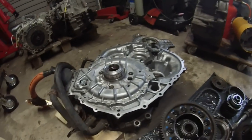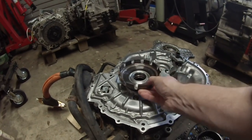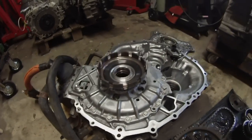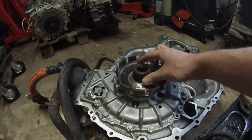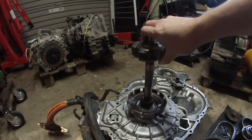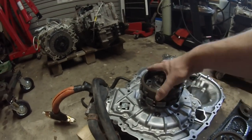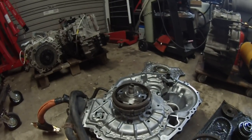That is because of this part here which sits in here. So I'm going to put some of the components in. This is the power split device — this guy here is our MG1. What we have done is basically modified the power split device. This is the sun gear and that is connected to MG1's rotor. What fits in on top of this is the planet carrier. Now the planet carrier and the ring gear normally form the power split device.